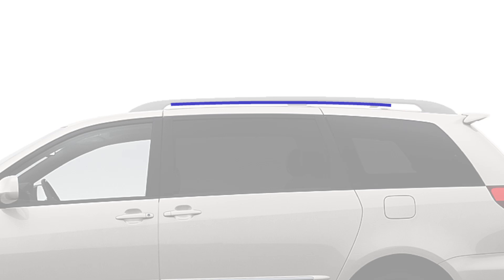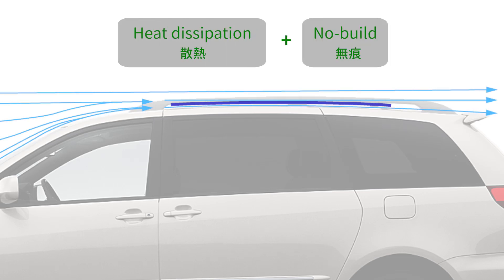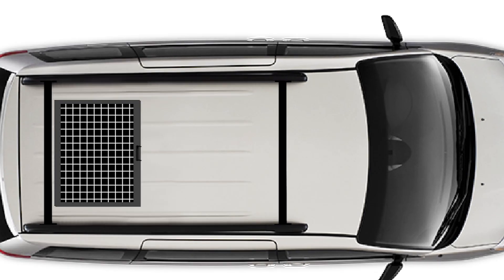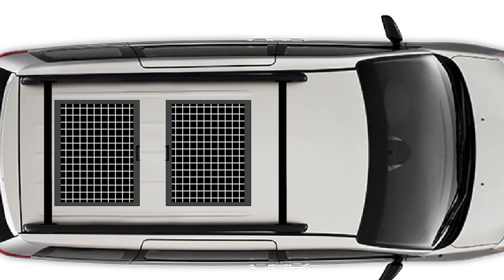My plan is to mount the solar panels flat against the roof with a small gap for ventilation, avoiding any marks on the car. I'll place two 100-watt solar panels, each 80 by 60 centimeters, side by side, leaving a 20-centimeter gap in the middle where the cables will come out. The panels will be connected underneath with an 80 by 25 centimeter piece of PP corrugated board to keep them as one unit.